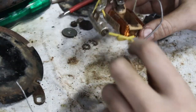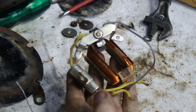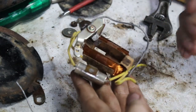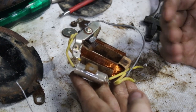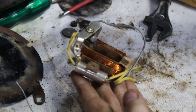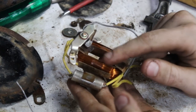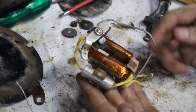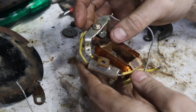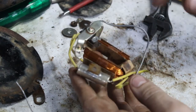One thing I never understood when I was younger — I'd see electromagnets like this and get a copper wire, strip all the insulation off it and wind it together, and could never work out why my magnets didn't work. This stuff that looks like bare copper wire is actually copper wire with lacquer on it — lacquered copper windings. The closer you can get the copper windings together, the better the magnet works, which is why they use lacquered copper instead of rubber-coated copper. I was shorting it out because it wasn't the right wire.